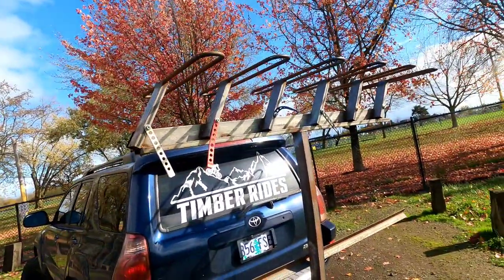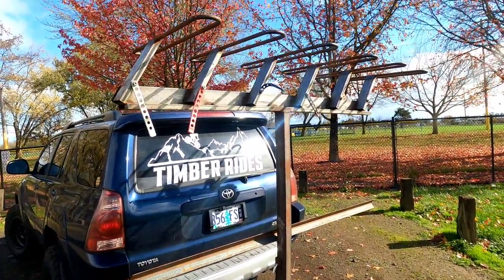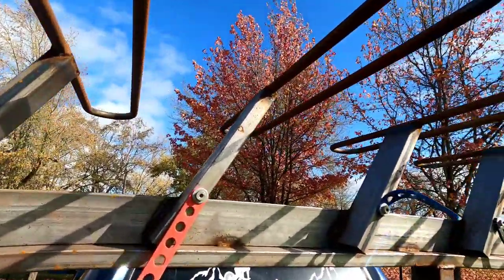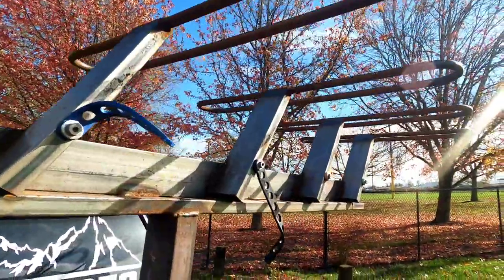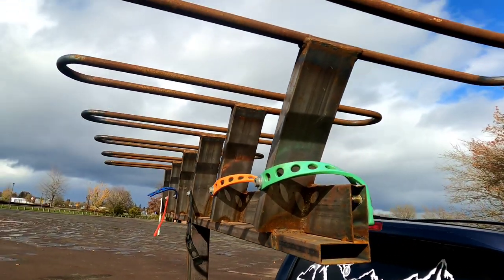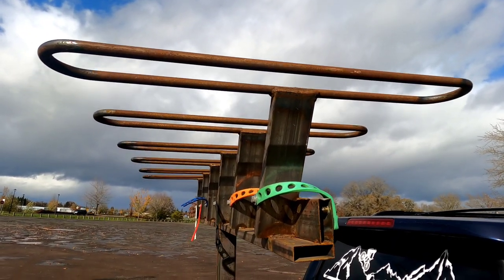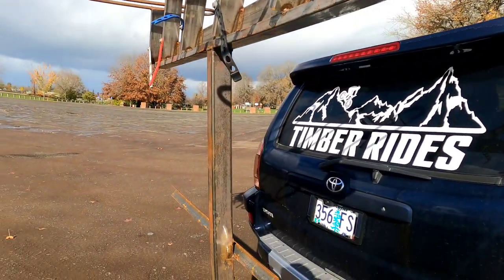Here's the rack. I kind of based it off of a Velocirac but I took some ideas from some other racks as well. It's got the loops on it. I had these particular ones made, but on my old rack I made them myself — I would definitely make these myself again. It's pretty easy to do: you just need a metal table, weld a couple of round pipes to it, use a torch to heat it up and bend them. I used five-eighths inch this time instead of three-eighths.